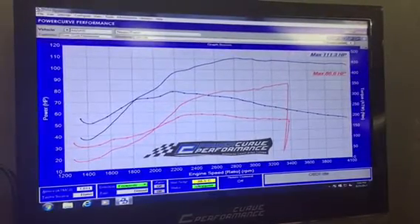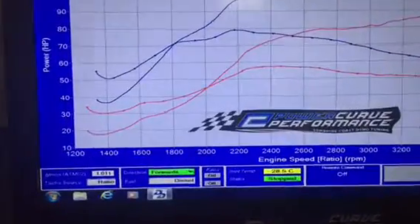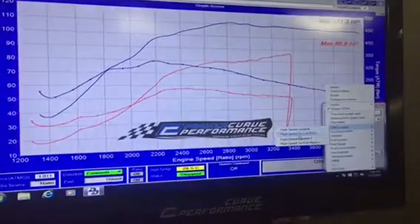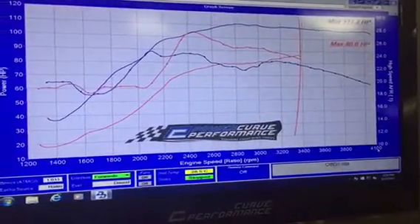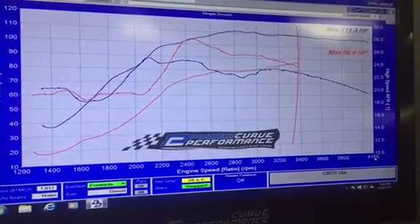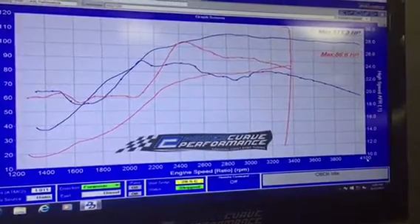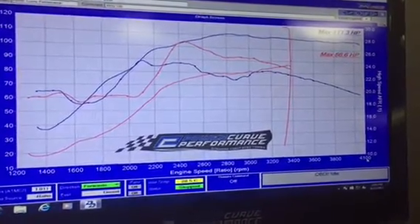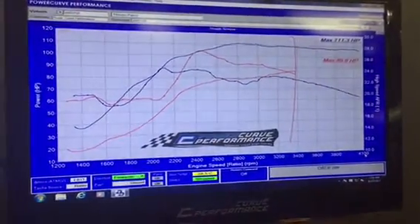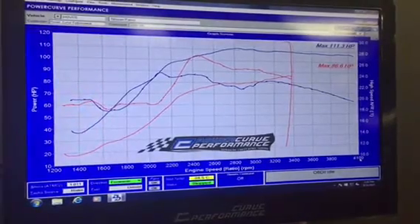Just a little bit of feedback for people to understand what we do. If we flick over to our air fuel ratio, you can see nothing extravagant there — we're all pretty much above 20:1 the whole way along, starting at 18s, nearly factory. These things are always a bit wiggly and wavy — it's a bit hard to smooth them out, that's just how they are, very heavily dependent on boost and airflow. So another good thing to keep in mind: keep your airflow meter clean and maintain regular servicing.